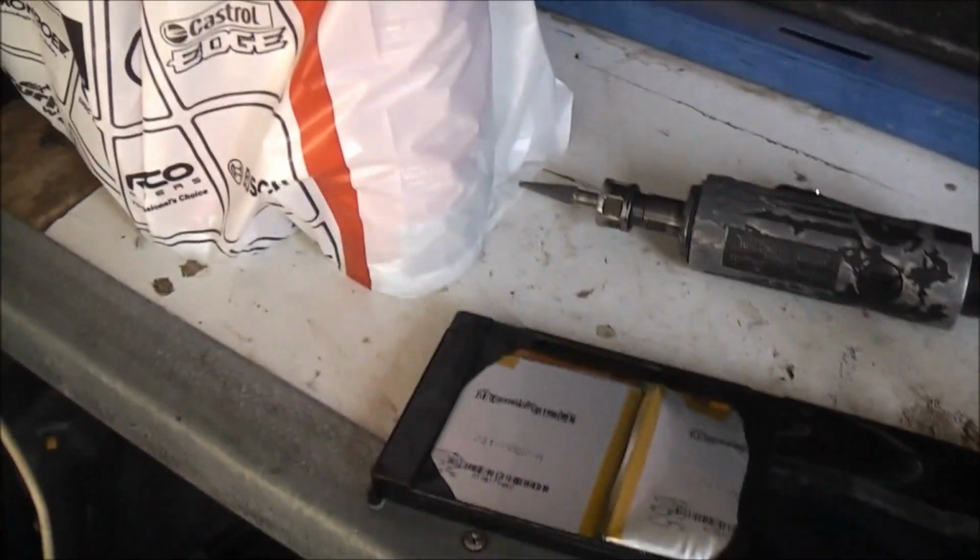We've got 6 cells instead of having 6 18650s like normal laptops have. Apple, just to be nice and flat, uses these lithium-ion polymer cells instead. And they like to puff up.